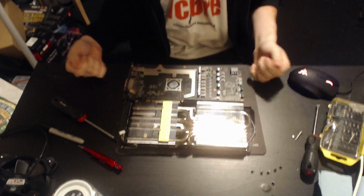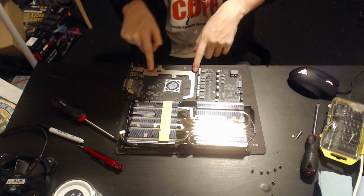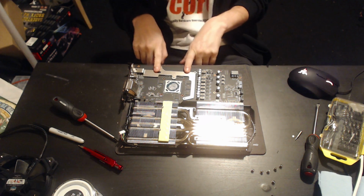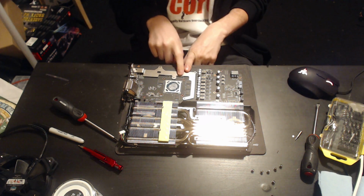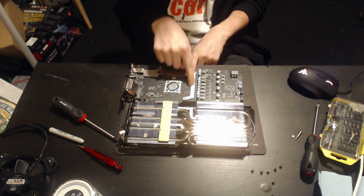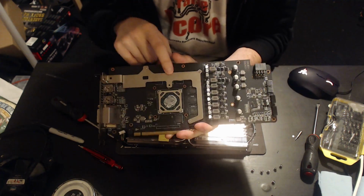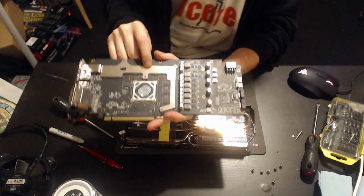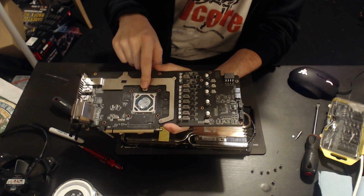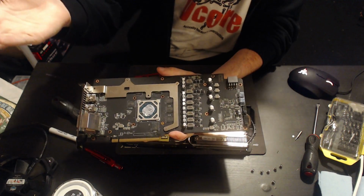That is the card. You have this metal clip thing, which is not a heatsink. This is mostly to improve the rigidity of the card. And I base that off the fact that while there's a thermal pad right here, and there is a thermal pad on this part, neither of those thermal pads is doing a whole lot. Well, this one's actually sort of helping that area of RAM, but those are the memory ICs that get the best airflow. These two are just completely uncooled. These 3 aren't cooled either.